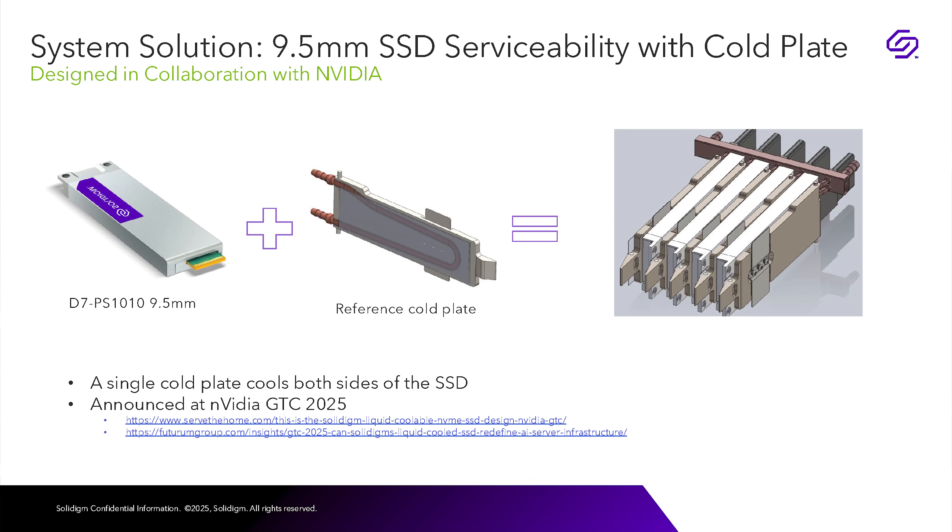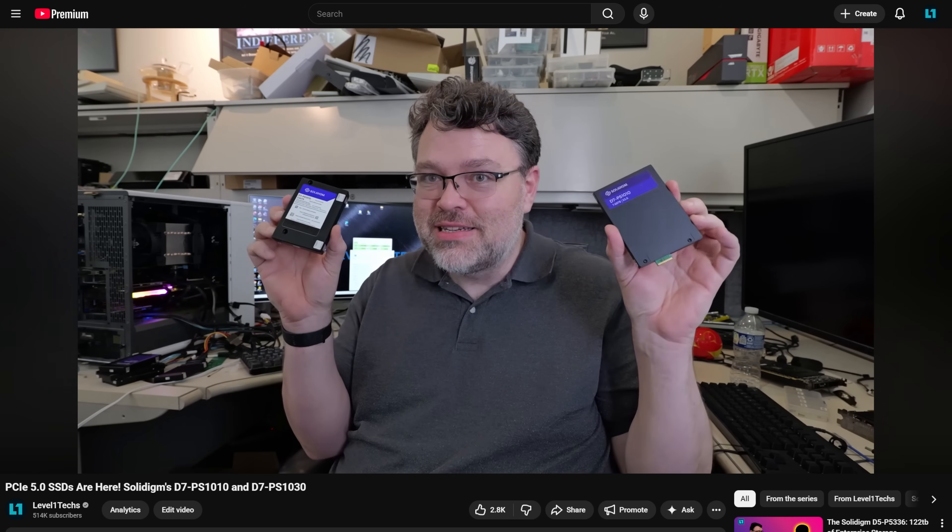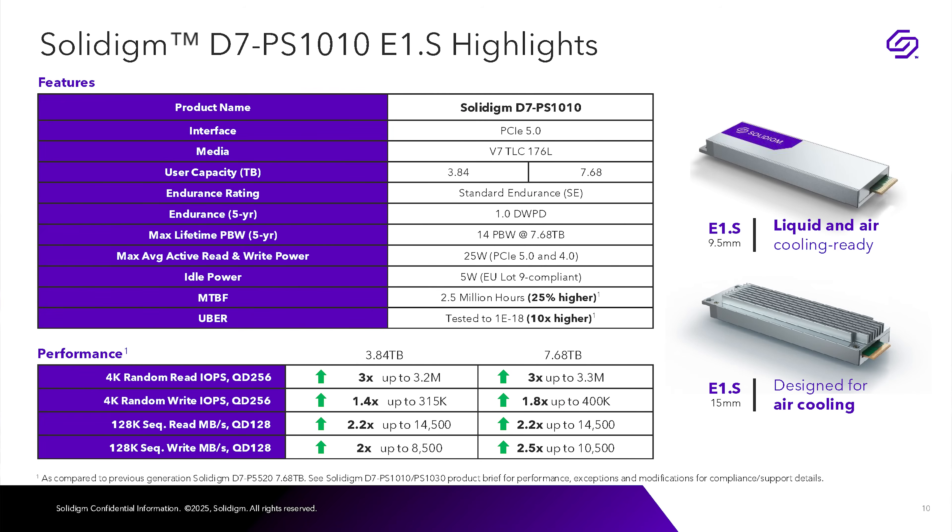There are a couple of outlier designs out there, like the Intel P4500 with its separate heatsink carrier, but that is largely an obsolete design. These are PCIe Gen 5 SSDs. In testing, I was a little surprised — we tested the PS1010 last year in the E3 format, and things have improved since then. We're able to do 3.3 million IOPS; I was getting about 3.15 million IOPS on the E3/U.2 version, but the E1 version is actually a little bit faster, likely due to firmware updates. At Q-depth 256 4K random, it's up to 400,000 IOPS, and 128K sequential read is 14,500 MB/s — just a hair faster than before and very near the PCIe Gen 5 limitation.